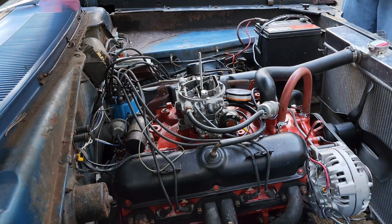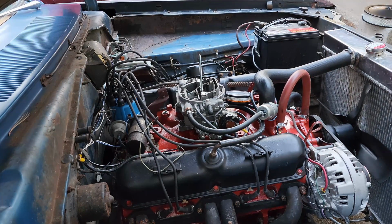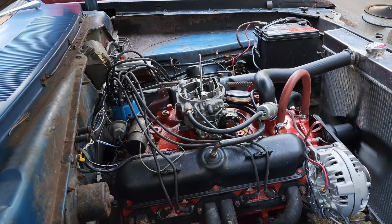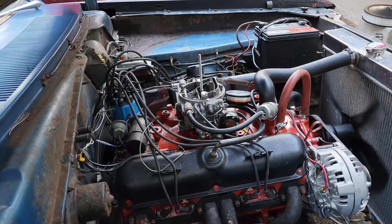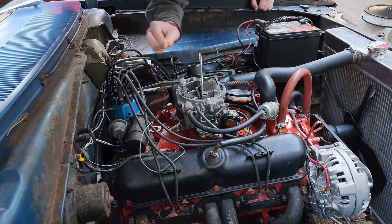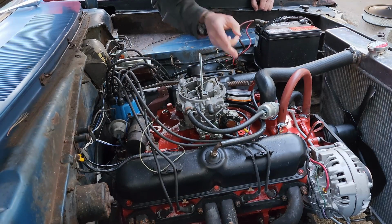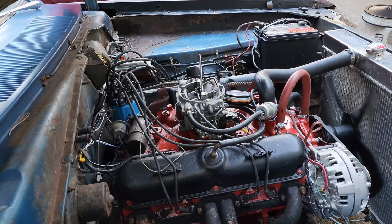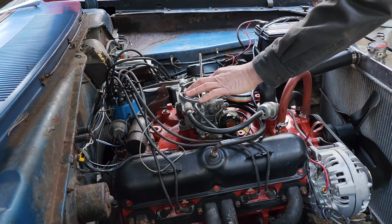Battery charged overnight and is fully charged according to the little blinky green light on the wall. We got the battery on, it's got fuel. Well, let's give it a shot. I'm gonna try closing this up just a lot, and see how that works for us. Oh yeah, I smell lots of gas. I may have pumped it a few times too many. Give it no choke and open it all the way up and see what we get.